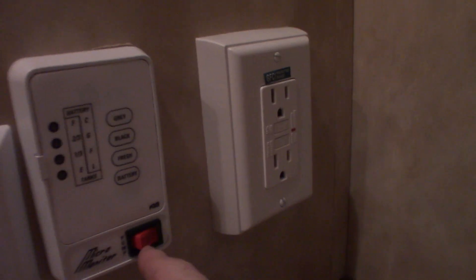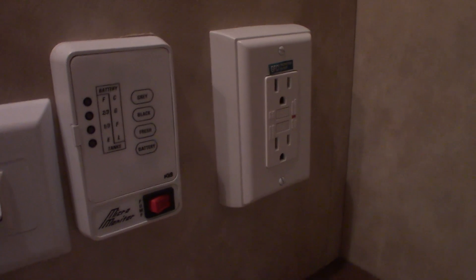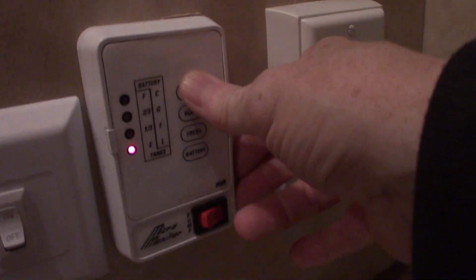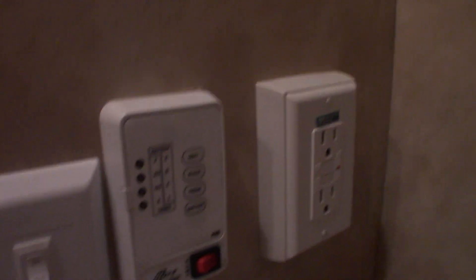You have a power vent here in the bathroom. The sink and shower work like any other sink and shower. Over here you have a GFCI plug — all the plugs in the trailer are wired through this GFCI, so if you're using another plug and it pops, it's reset right here. This is how you turn the water pump on that I told you about. You use that pump if you're pumping water out of the fresh water tank because you don't have city water, and also to winterize the trailer. You can check the battery level, gray, black, fresh, and so on — these graduate up in one-third increments. Once you get past two-thirds you're going to start thinking about dumping the black and gray tanks.